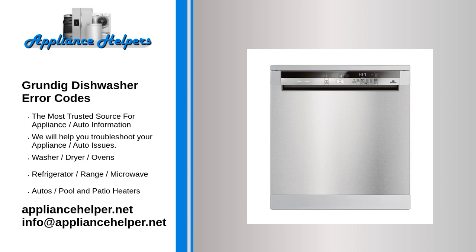C2: The total pump out cycle exceeds 7 minutes. Press reset to stop the beep. C3: The dishwasher will not drain. Disconnect the power at the circuit breaker for about 30 seconds and then reset the dishwasher. If the problem persists, contact service.